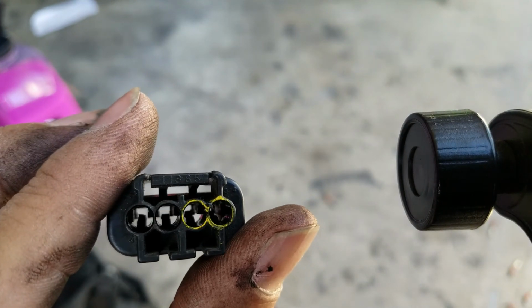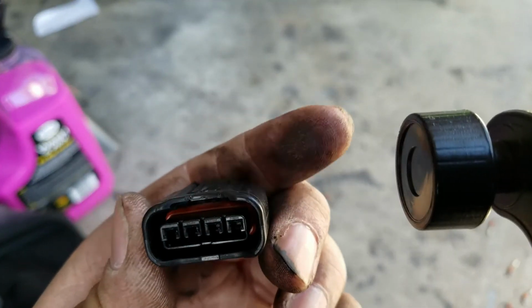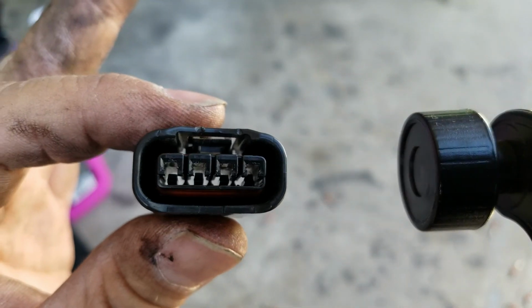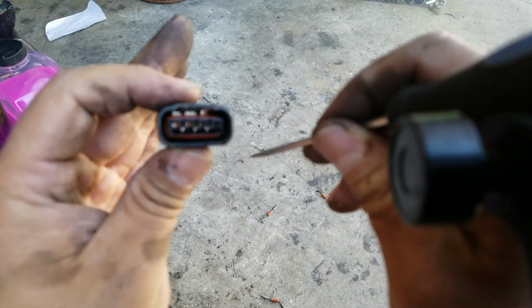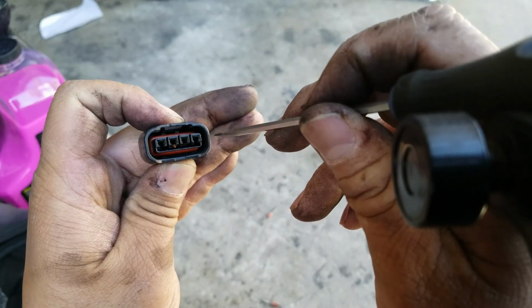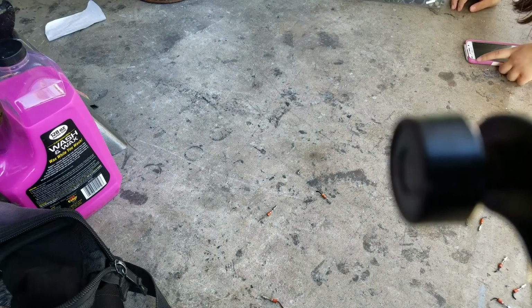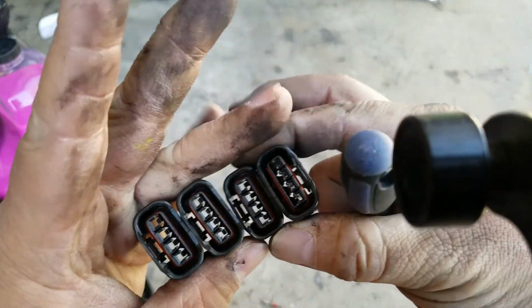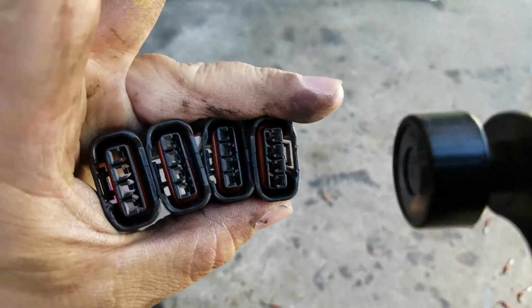Those are the pieces. Those middle pieces right there are what you push away from the clip. You'll probably be able to see better now. Yeah, those four middle pieces. Just push it in and then down. In, down, and then pull out. I've already done four of them right here, so we're gonna go install it into the Camry. Just keep track of your wires because it matters.